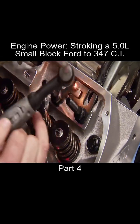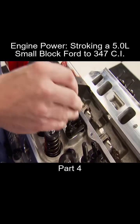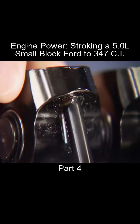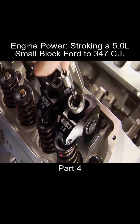Using a TIG welder, tack them together in 3 places. Using a MIG here will get too much splatter on the engine. Now drop in the pushrods and apply extreme pressure lube on the contact area between the pushrods and the rocker arm cups to protect them during initial fire-up. With the number 1 cylinder at TDC, we'll set its valves up at a 1/4 turn past 0 lash.